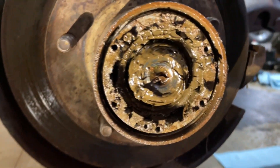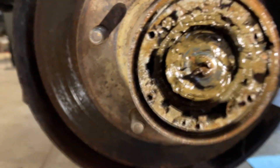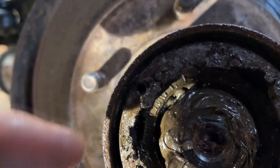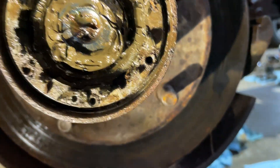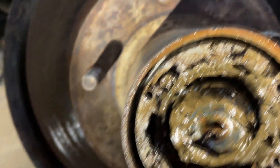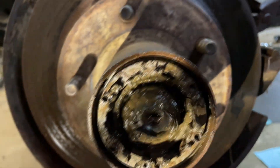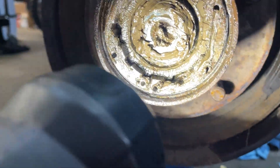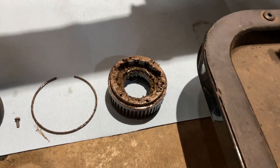The little screw loosens up this front piece. You can see there is a clip - it's like a massive snap ring. You run a little flat head around there, feel where it meets, and pry it out. Get the snap ring out and then this whole assembly should come out. And there it is - we got that out.